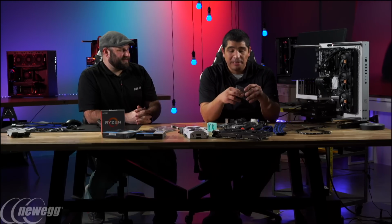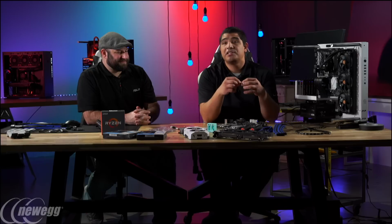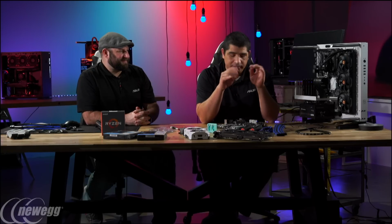This right here is probably my last tip, if you are applying your thermal compound. There's always the great debate: how do you apply your thermal compound? I'm going to generally recommend that in most scenarios, what you hear is the general convention of applying something the size of a grain of rice, or maybe two grains of rice. That's generally accurate. But what it really comes down to is clear, consistent, fairly thin coverage.